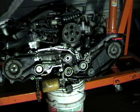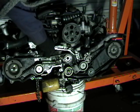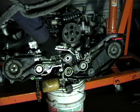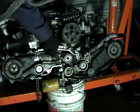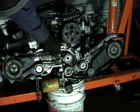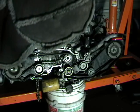This car has 105,000 miles. It looks like the timing belts had probably been done before — the tensioners looked really good. But we have a little bit of slack in the top half of this belt, which usually after running new belts they can stretch a little bit, or if they are not installed properly you are going to have that problem.